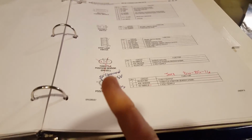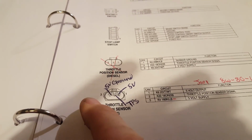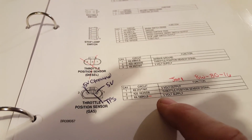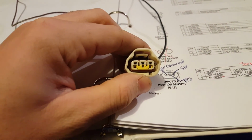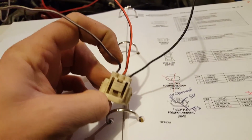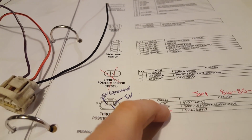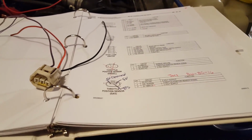Alright, follow me. TPS sensor. Look at the way that this picture is represented, as if the clip is on top. And number 3 should be the 5-volt supply. It should be black and light blue. Here's my sensor. If we look at it like this, number 3 should be the first one, and it should be black and light blue. It is not. It is violet and white, which would be number 1, violet and white, 5-volt supply. Originally, I had these switched, but on paper, you can see that it shouldn't be switched, because if I go to the Jeep section, guys, this is pissing me off.